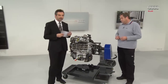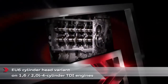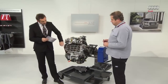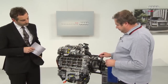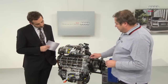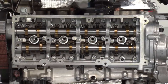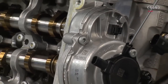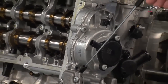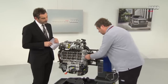Let's start by looking at the changes to the cylinder head. What changes have been made to the cylinder head to comply with the EU6 standard? On the cylinder head itself there is the variable valve gear created via a camshaft adjustment. Inside, the cams are set up in exactly the same way as for the EU5 variant. Only the camshaft adjuster has been added at the front. Here is the camshaft adjuster, the solenoid valve that actuates the control valve inside, and this here is the accumulator.